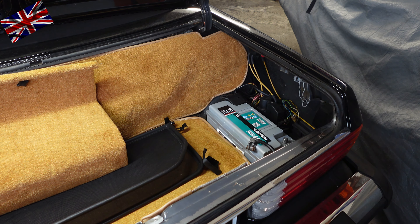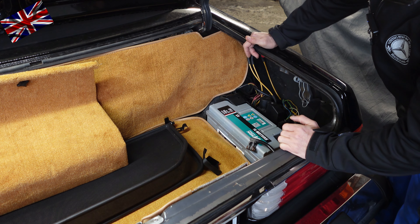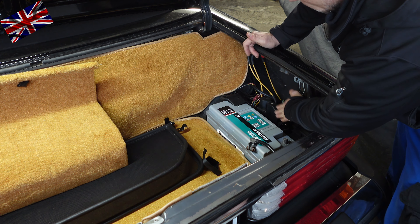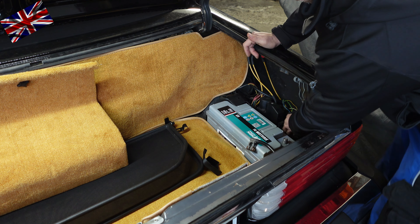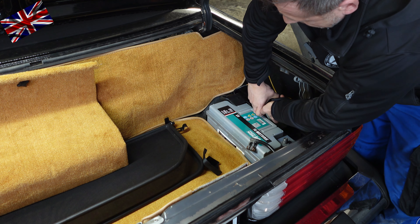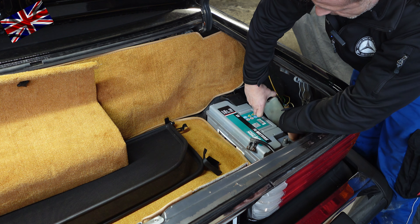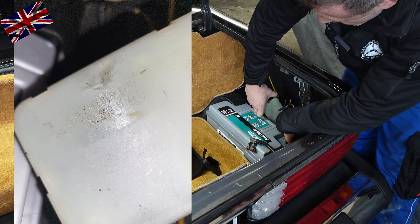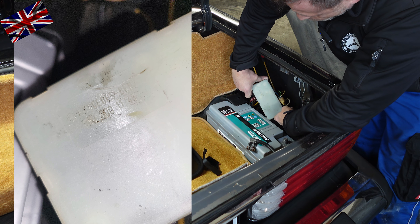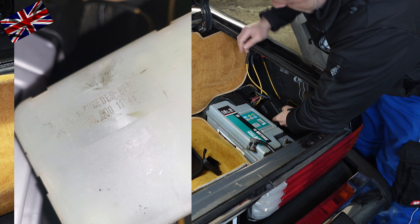In the boot, next to the battery, is the vacuum pump. By turning it upside down, you can tell if the pump is of the last generation. The older pumps have a black cover at the bottom. After 1986, they changed that to a sort of whitish cover. The part number is shown in the picture on the left. They usually mount the pumps in rubber foam envelope-like boxes, which is obviously gone missing here.